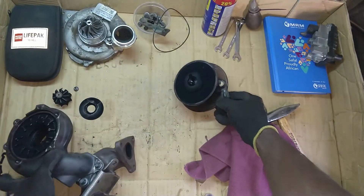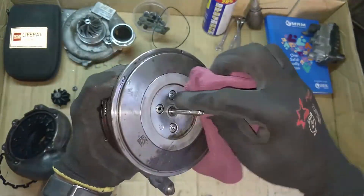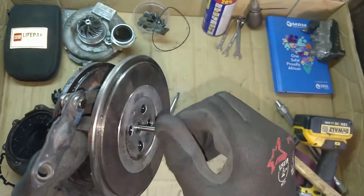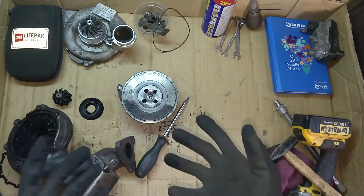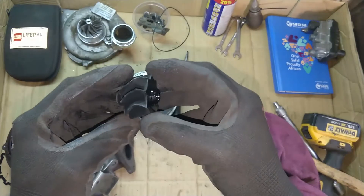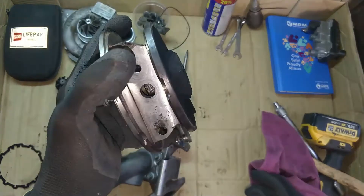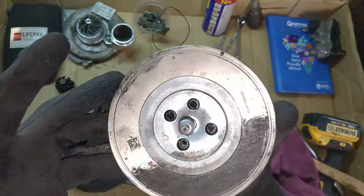That's pretty much the autopsy. So maybe we just review the cartridge a little more — this was definitely oil leaks manifesting here. Maybe we should take this off and see what we get, but for sure: catastrophic failure. There is your OM 642 turbine and everything that makes it work. The impeller housing and the exhaust housing are still in fair shape — those can be reused should we get another cartridge. But as for the cartridge itself, maybe it's also not so bad and could possibly still be put to use if it was to be rebuilt. We'll wait and see what we can do with it.